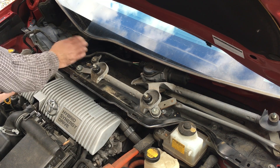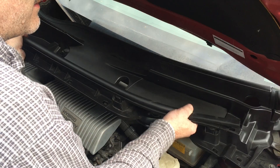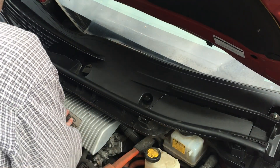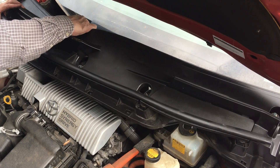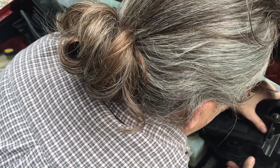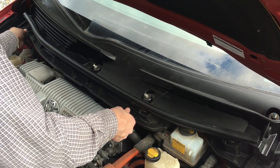The wires should just click back in place. Looks like that little clip came out, but we can push that back in. So I've got that side started with the wiper motor in. I still need to pull up on this and get this side to slide in. Make sure this side's seated properly. Now just push the clips back in, and put your two pins back on the corners if you've got them. Put the wipers back in.